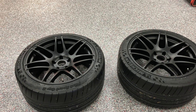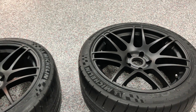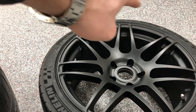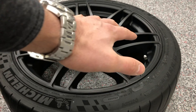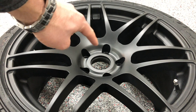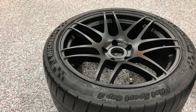Since I didn't take the camera with me into the paint booth, I'll go over how I painted the faces of the rims to avoid overspray and runs on the spokes. I started by painting the sides of the spokes first, going all the way around the rim and then back the opposite way to get the other sides done. By doing this, the overspray covers the top face. Same with the bolts — I did the bolt holes first to ensure full coverage, and then the overspray handles the inside of the hub. I did that for two coats, and then my final one was just an overall top coat to give a nice finish.